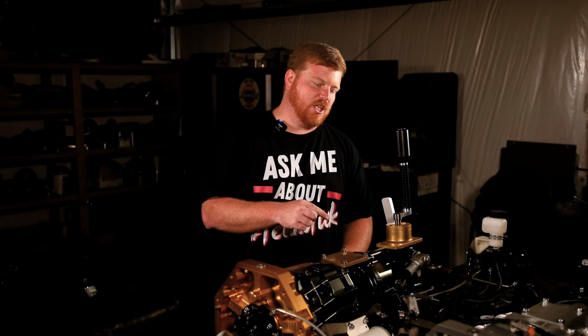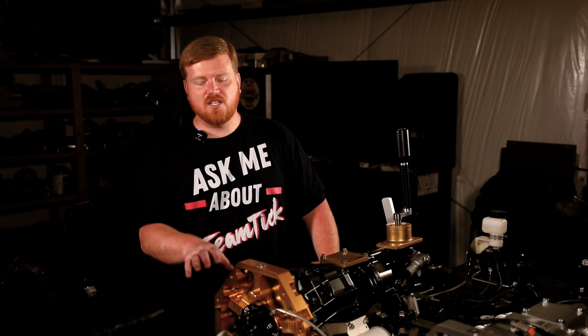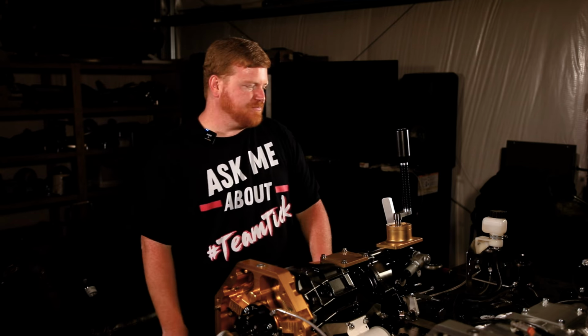You would see a little less than that travel-wise in a car, in an application where it's actually moving a pressure plate, because it will have to build up a little bit more pressure to actuate the entirety of the travel. So probably going to discount several thousandths, between 10 and 20 thousandths, from the travel of what you see here versus what you'd actually get in a car.